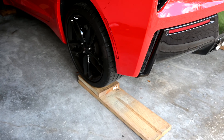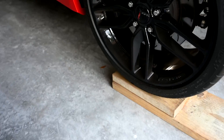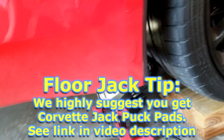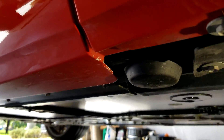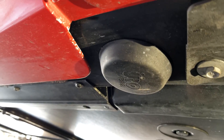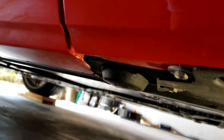If you don't like to use floor jacks, you can drive your car up onto a couple of 2x10 boards to get it off the ground. That's as far as you really need to go in order to reach underneath to where the oil plug nuts are. Here is where you will find your jacking puck, also known as a jacking pad. You put it right under the underside, attached to the frame at the lift point, right where you would scoot the jack underneath. This will protect your panels from potential cracking. The first thing you want to do is run the engine for a few minutes to warm up the oil so that it flows better and drains much more completely.